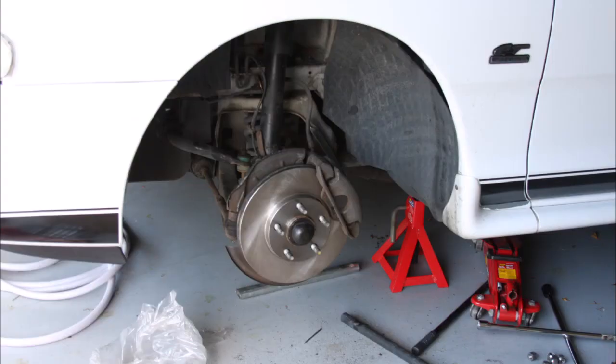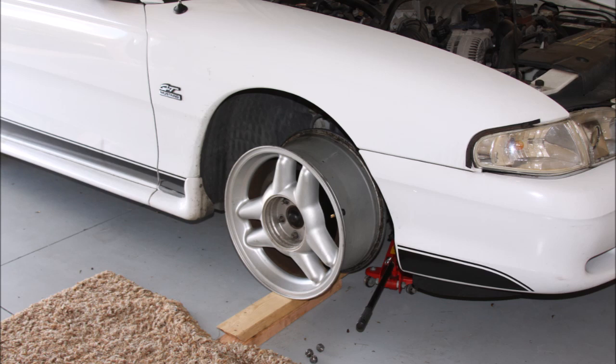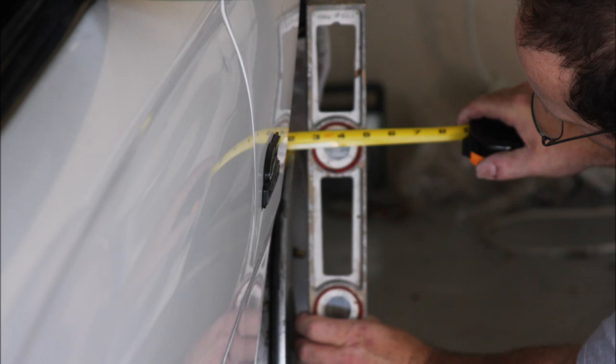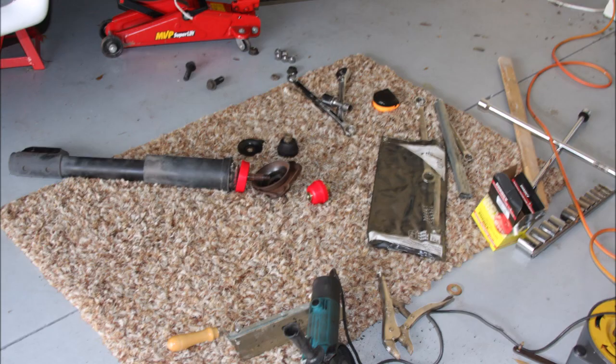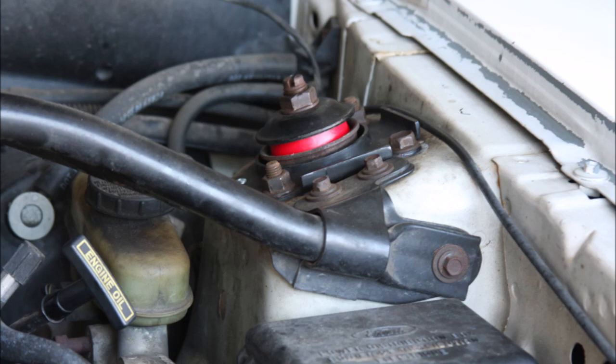Here's a picture of the new brakes I put on the car — first thing I had to do. I bought some stuff off Rock Auto and spent a day doing the front brakes. The front end was really messed up. I mounted the front wheel and did a backyard way of checking the camber — it was way out. I put in some urethane bushings on the strut towers to tighten things up, and every little thing I did with the suspension helped.